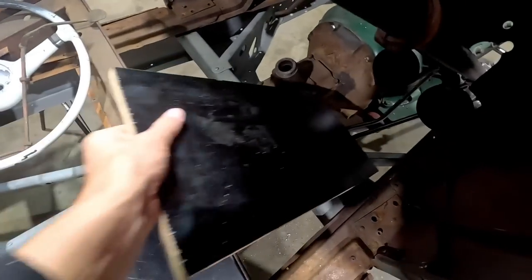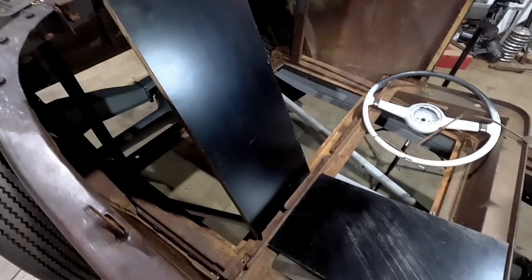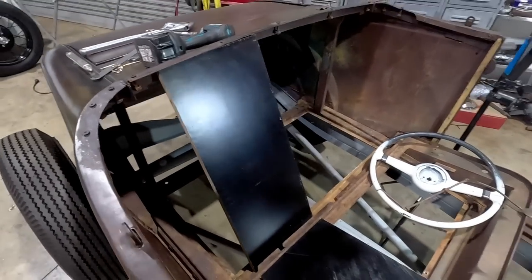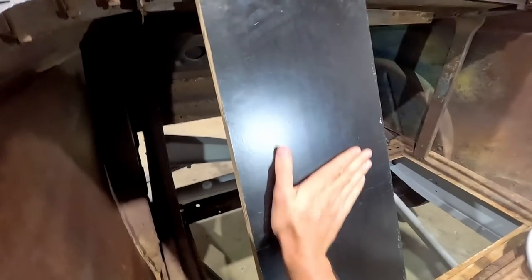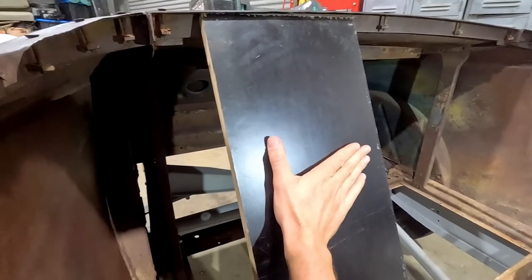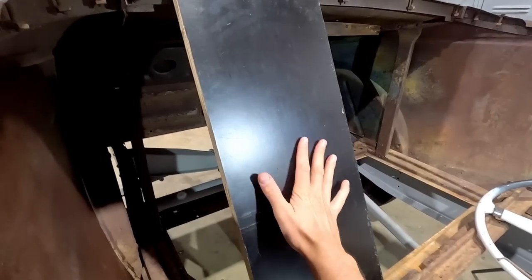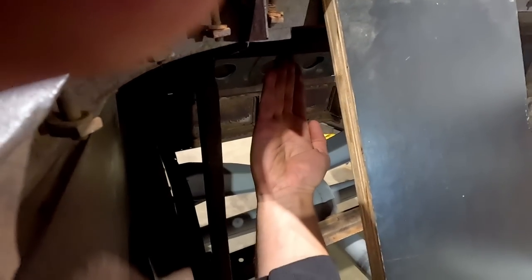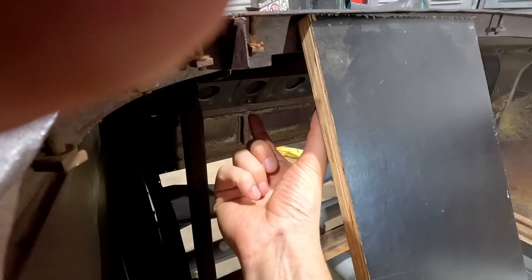Let's just put this guy back in here. So there's our floor. This is our stock Model A seat base. This is the back. And what you see, the form ply here, I want this to be the highest point. The actual finish outside of the leather is right here, which means if I were to lean against this, my back would sink in a little bit. So realistically, it'll actually sit back here, and there's probably 3 or 4 inches of padding and foam and stuff like that.